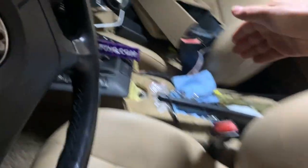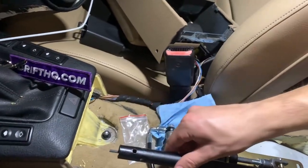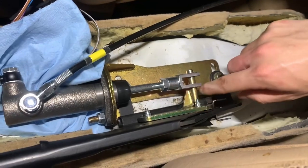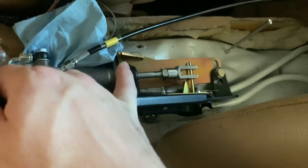I went out to try the handbrake and nothing really happened. Once I pulled it all the way up — I was really pulling — I got some response, but that was it. I was going about 25 mph. I think when I adjusted it maybe it doesn't have enough throw now. I tried bleeding the car with the handbrake this time and it worked on the stands — I put it in third and pulled the handbrake and it locked up. But I don't know why it's not doing it when I drive now. My theory is it doesn't have enough throw, so I need to move it back so it pushes more. If that doesn't work I'll try bleeding it again, and if that doesn't work I'm probably just going to buy a different handbrake. I've already spent 80 bucks on two of these and I'm 0 for 2.